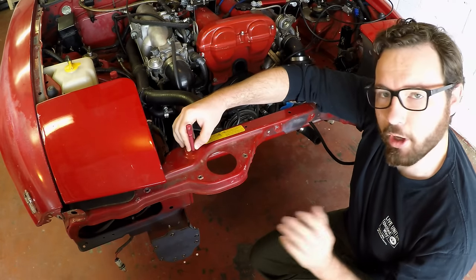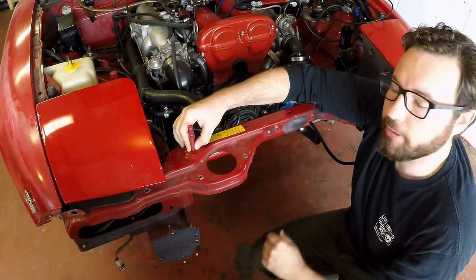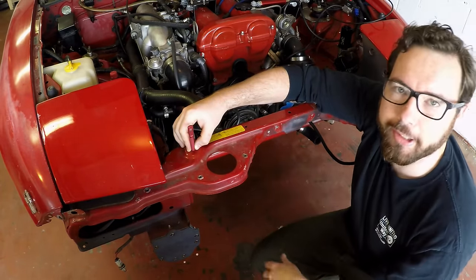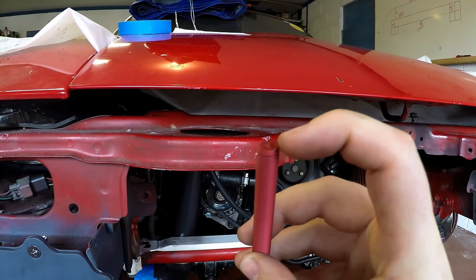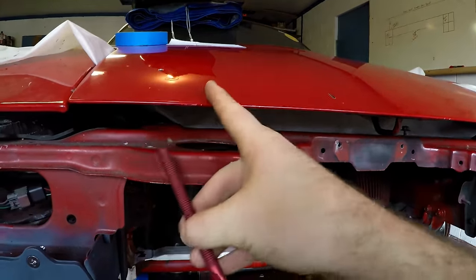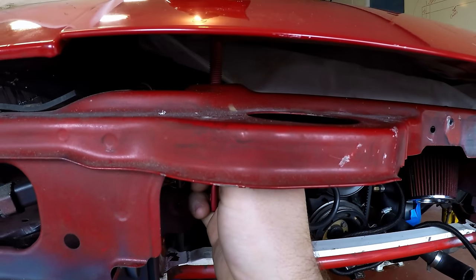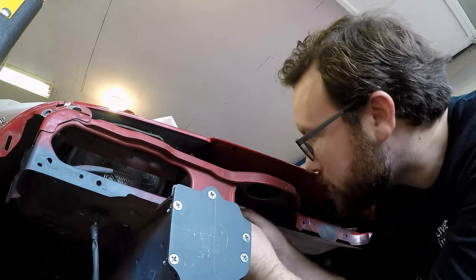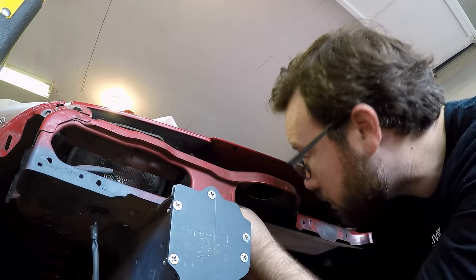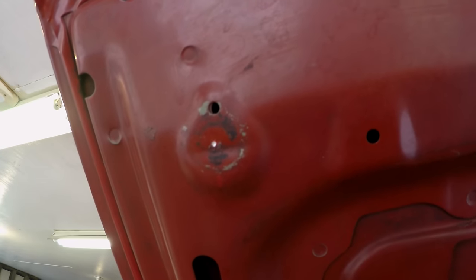It's pretty straightforward and simple. I'm going to drill from the bottom of the hood because the area the stopper hits is already marked out on that hood, so I know exactly the center point. Then once I get that I'm going to take the template over the top where that hole is and trace around that area and start cutting. What I'm going to do is put just a dab of grease — in my case dielectric grease — at the tip of the pin, bring it up and through, mark the location of where it hits, and then center punch there. I've already punched a small center hole and I'm going to drill right through that center.